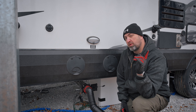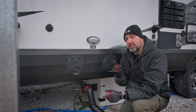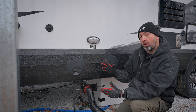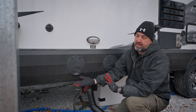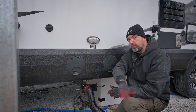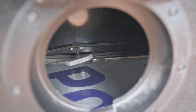Another problem we faced back in December was that the pipes in the bathroom froze up even though we had water in the rest of the rig — just this bathroom side froze, which is on the north side. We also saw a video from Jared Gillis with All About RVs saying that the low point drains need to be insulated if it gets really cold, because they can transfer cold air up into the pipes. Our low point drains are right in the area between the frame and the outside piece, so I put a styrofoam box built up between the frame and the outside piece to insulate not only the low point drains but that whole side from cold air coming up underneath. And luckily our RV has nice little port holes so I can still reach in and get to the tank levers.